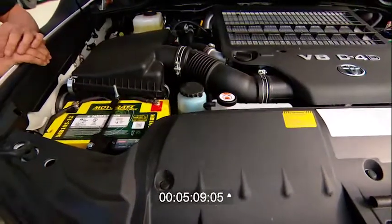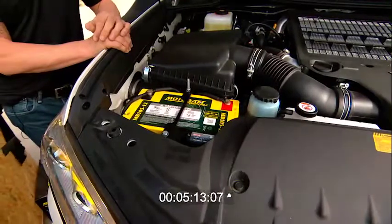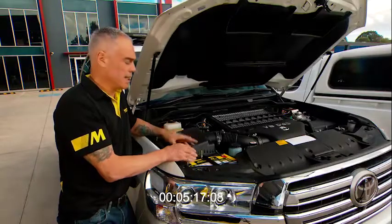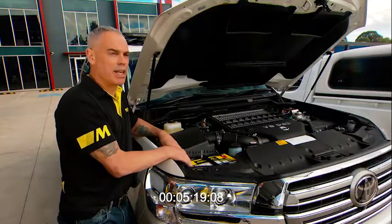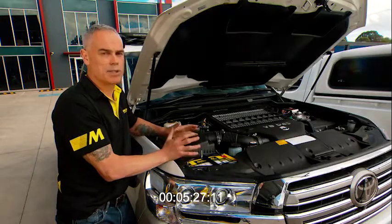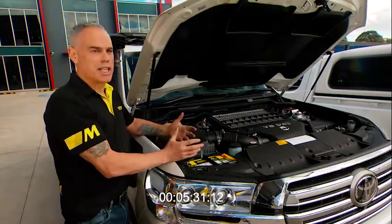So what we're able to offer here is a 105 amp hour battery case size, but we've actually got 112 amp hours of capacity there. At the 105 amp hour rating, we have a C10 rating, and I'll ask you to go to the website to have a look at some of the more specific discussions we have on the difference between C10 and C20, so you can educate yourself on that.